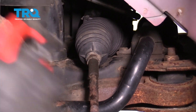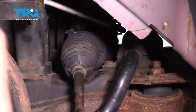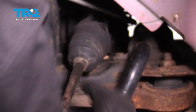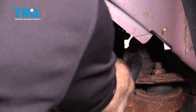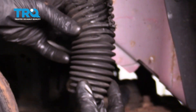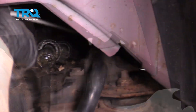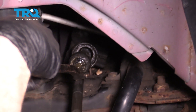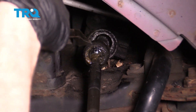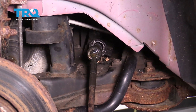Generally, you can go ahead and squeeze it with some pliers, pull it right down and off of there. And then if you were to follow the bellows boot in towards where the power steering rack is, there should be another clamp in there. Our bellows boot is in very poor condition — it doesn't have any of the clips and it's ripped. Go ahead and remove those clamps. After that, grab onto it, give it a little tug and remove it from the vehicle. Obviously, if your boot looks like this, it only makes sense to go ahead and replace it. Now to minimize the greasy mess, I'm going to wipe down this entire area along here and also make my way up around the rack as well — just try to get off some of that grease so we can continue working.